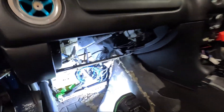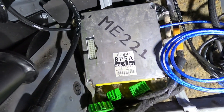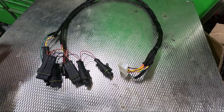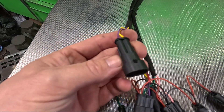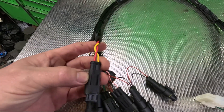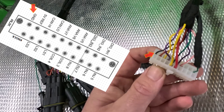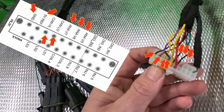I'm running an ME221 standalone ECU, generation 2, and that has an options port. This here is a patch lead I've made that goes into the options port to run all the accessories. I've only pinned out the ones I'm using: the purple and yellow going to our CAN check gauge, the green digital input going to the flex fuel sensor, the big yellow and red going to coil pack 3 and 4, and the 5 volt sensor wires for the additional sensors — 5 volt sensor ground, 5 volt sensor positive, CAN high, CAN low, three analog sensor inputs, one digital sensor input, and coil pack 3 and 4.